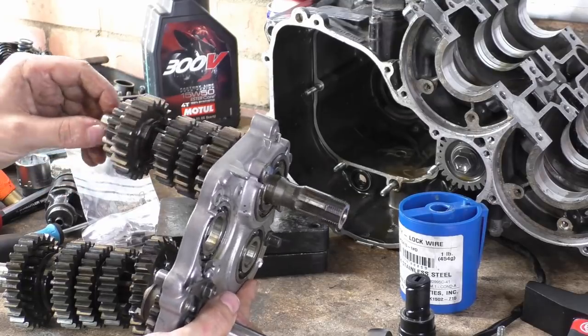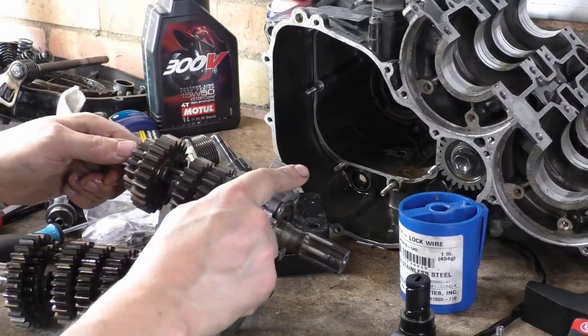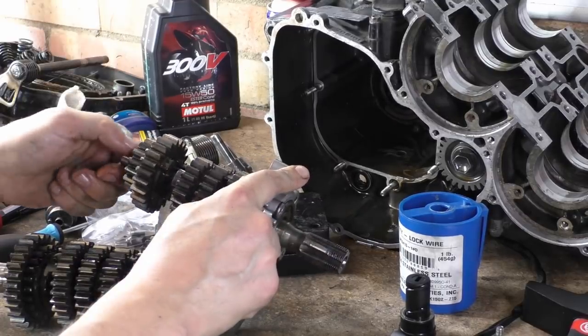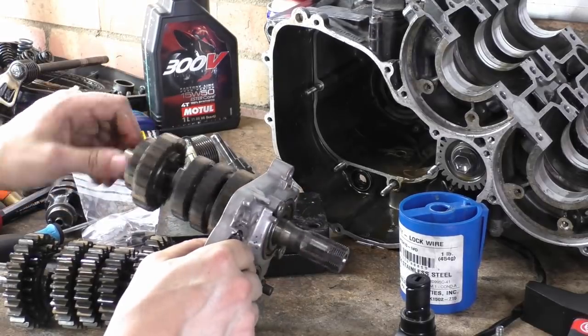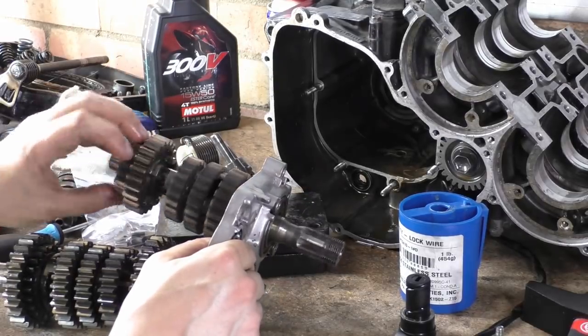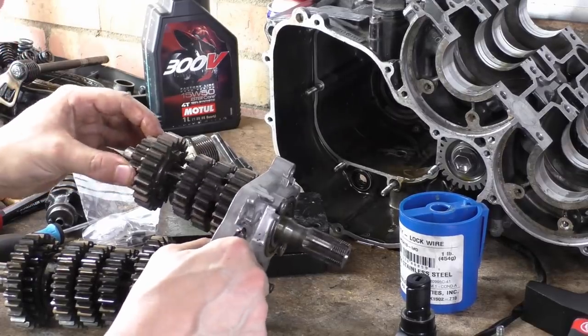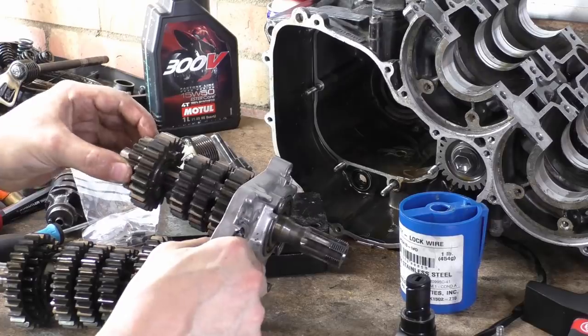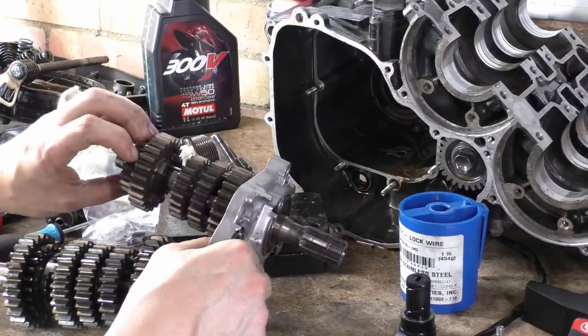These all feel great. What I do to bearings is you grab it, try and rest it down and give it the up and down. Like that. I can't feel anything in that bearing. It's not under load, so you go, wow, look at that spin. Yeah, but it's not that. I'm trying to look for clearances. Any wobbling, backwards and forwards thrusting. What's the run out of the shaft when you give it a spin?